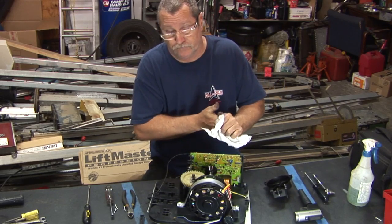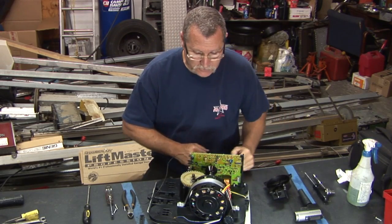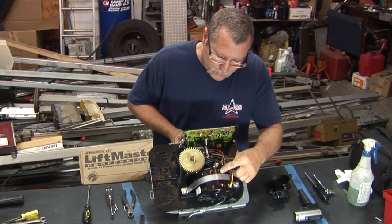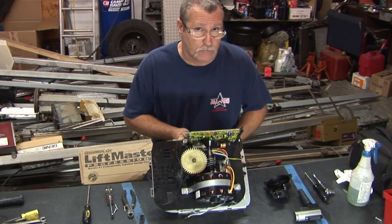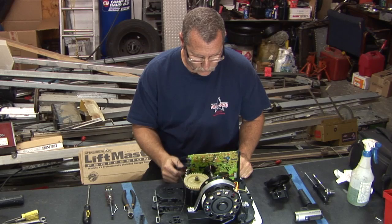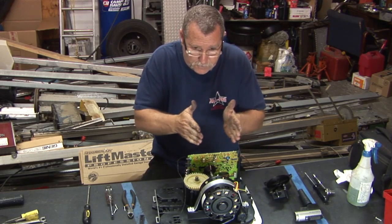You've got a chain that goes down the rail, and the principle on this is compression. The motor drives the worm gear, spins the helical gear, which turns, I'm sure, a sprocket on the other side. We'll get to that. But it pushes one row of chain down a rail. When you're pulling, that's one thing. But when you're pushing, the links are kinking, the rail's keeping it compressed.